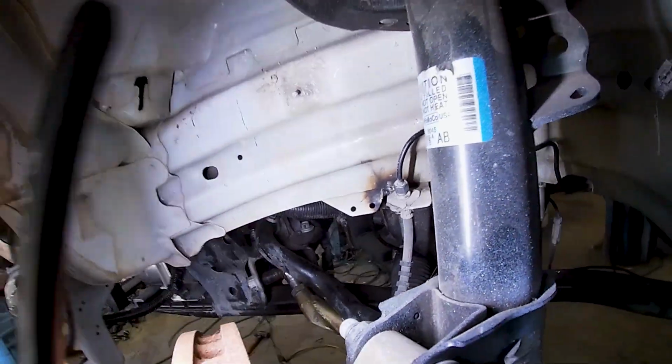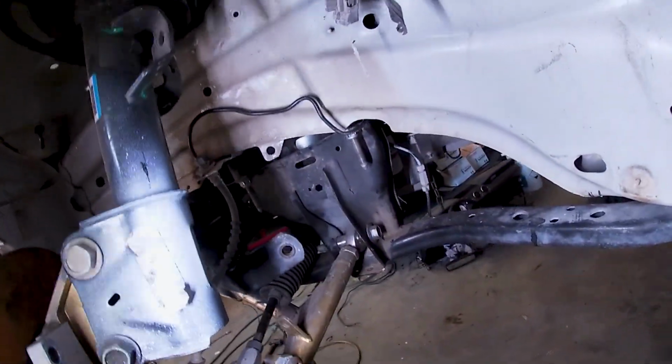And then on this side, I was lucky because I pinched the brake hose. I got the right fitting on the brake hose that I used, because there's like a coarse thread and a fine thread on these cars. So I was able to use that, no problem. Pretty cool. Then when we go to the back, the Mustang has a coarse thread